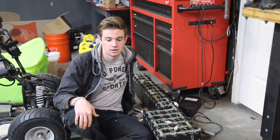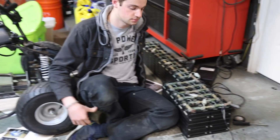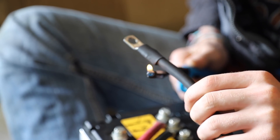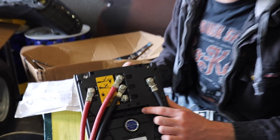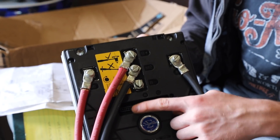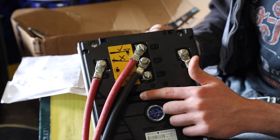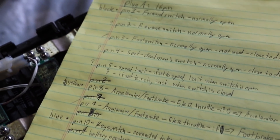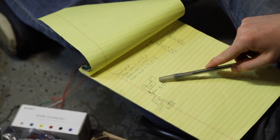The next step is figuring out what wires go where and wiring up our converter and motor controller. Now that we have the wiring diagram, we have the main power and ground from the battery going to the armature and field on the motor. There are three pins on the motor controller — really we only need one; the other two are for screens and monitoring. Our 16-pin connector mostly just needs forward switch, key switch, and throttle. For now I'm drawing a little wiring diagram and tomorrow we'll get the frame out and mock everything up so we don't cut any big cables too short.